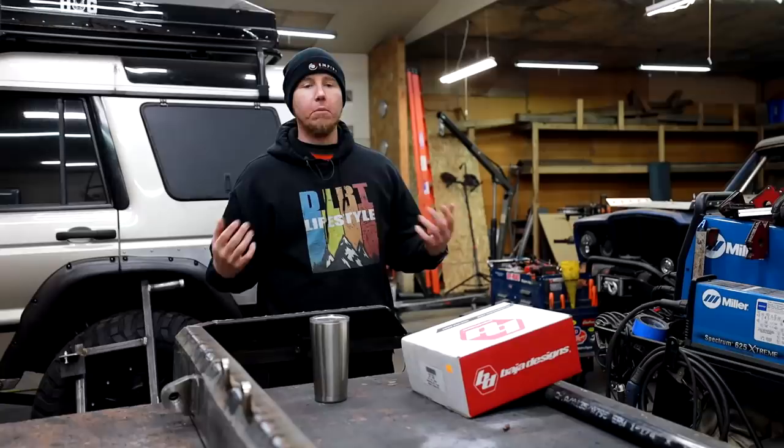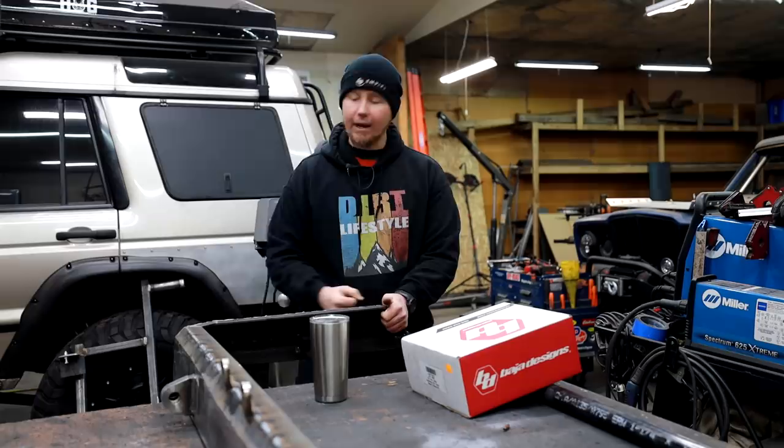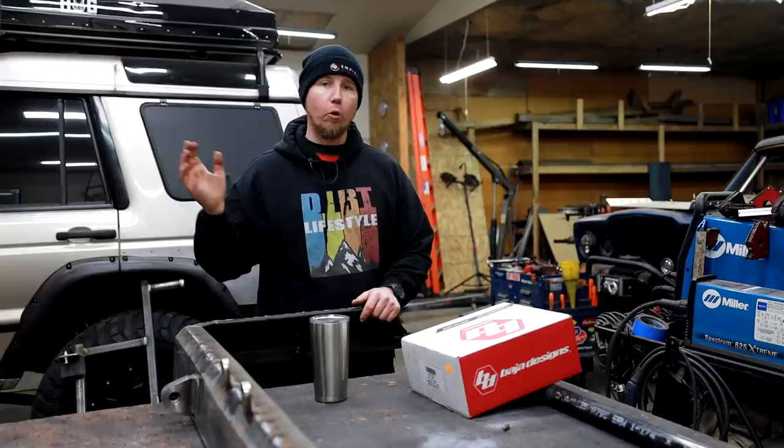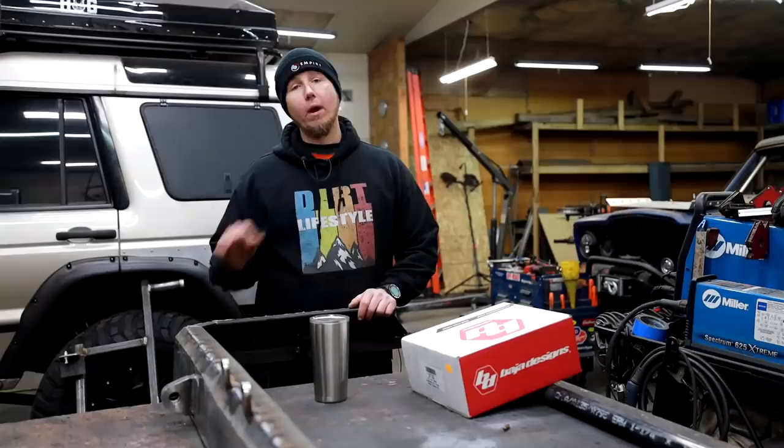Since we have a lower rim, it's going to make it so much easier for the bottom of the vehicle to eject obstacles out of the back as we move forward. This also makes the whole thing way more rigid — we finished up the box shape, and this is going to make it much more resistant to an impact from the side or the rear. If somebody rear-ended us, we don't have to scrap the whole bumper as long as it's around 10 miles an hour or less.